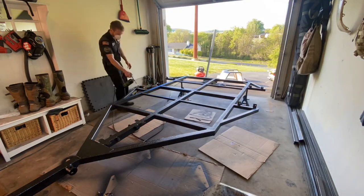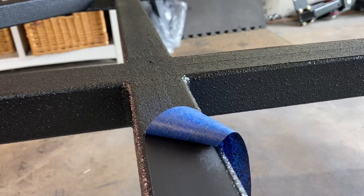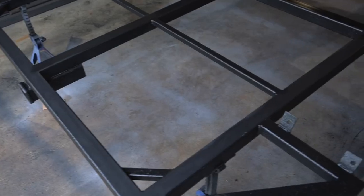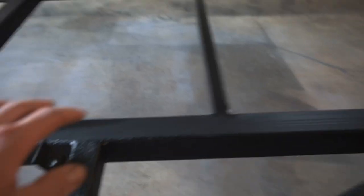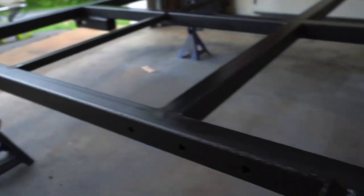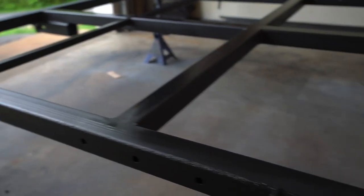You may notice there's masking tape on the top side of the trailer — that's because we masked off where our Steel-It is. I let the frame sit about 24 hours before peeling the masking tape off; it makes a nice clean line and keeps our surface exposed as planned. With the Raptor liner all dry, this whole top layer is just Steel-It, not Raptor liner, and you can weld through that stuff — so we're still able to weld the camper to the frame without leaving any unpainted surfaces.